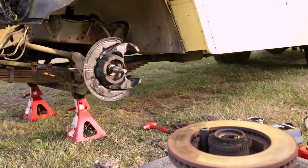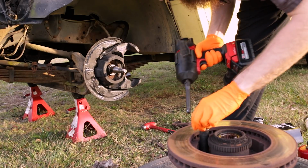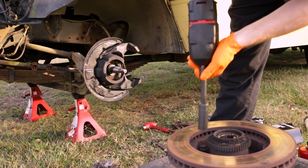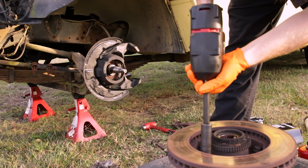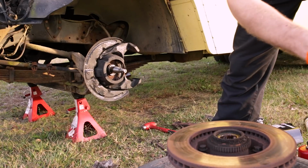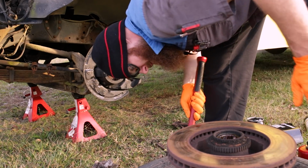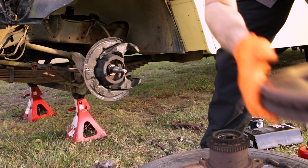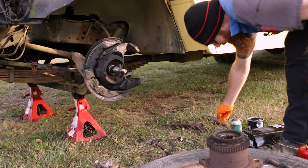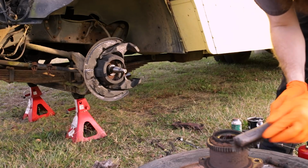All right, guys, let's try not to get any more stupid points today. I know in the video the other day, a lot of you commented, why didn't you just stick the hub in the wheel? I didn't even think about it, did not cross my mind. So this time that's what we're gonna do. Old rotor off of there. Let's clean up that tone ring really quickly, and try not to get a bunch of shmoo down in the wheel bearing, trying to keep the inner in place.